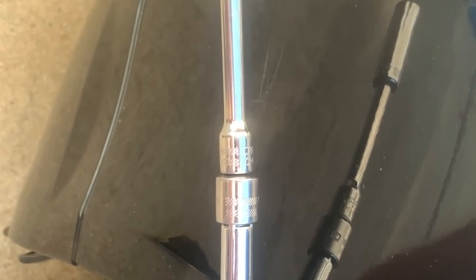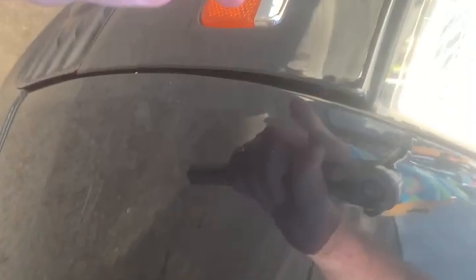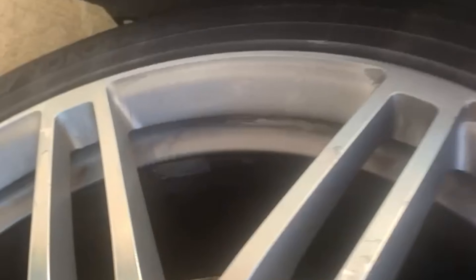It's handy to get a couple of extensions on your ratchet socket — you can see why, because we've got to get deep enough in there to get to the nuts. The connection point is right around here, so you've got to peel that rubber inner liner out of the way. Having a flashlight would be handy so you can look in there close to the fender and find those nuts.